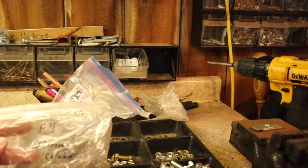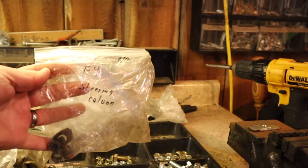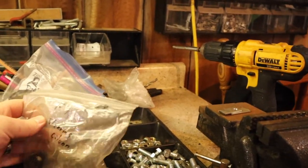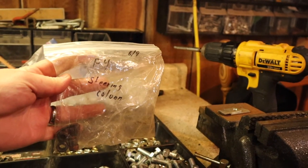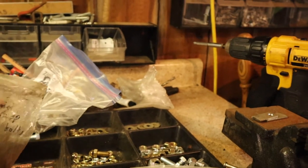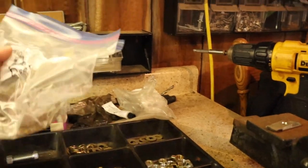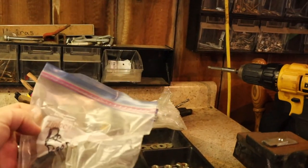In an organized system, put them away in a large container or storage box. That way, when you get to them, you'll have them nicely in order and you know where they go. Why label them with letters and numbers? Well, if I knew every single name for every part I'm taking off the car, I should have gone into auto repair service. Most of you can't name every single car part, so simply label them with a letter and a number in front of the camera. My strategy: A was for the first day, B was for the second day, and so on. So a bag labeled C5 means it was the fifth part taken off on the third day I worked on the car.